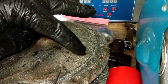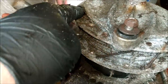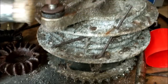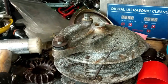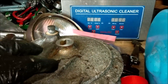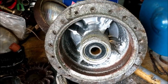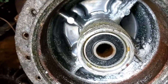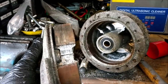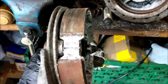Here is the rear hub - this was all one lump, all seized. I put penetrating fluid around the seal and underneath that lip all the way around last night, and I've just gently tapped it with my equalizer. It is actually moving, believe it or not. I'm going to pop this off in a minute and take a look inside. Getting the brake part out of the drum isn't easy because the shoes try to wedge and grip, but I've got there after 10 minutes.